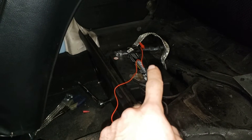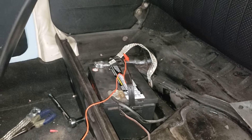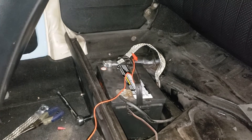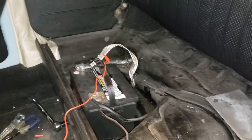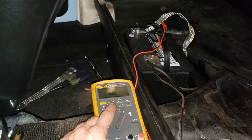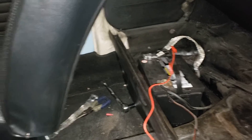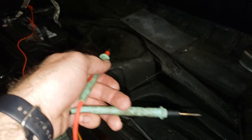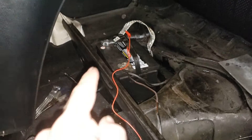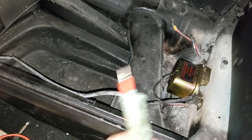We have a new ground strap, but we want to make sure there's actually a good connection to the body of the car. Just because the strap and the battery connection look good doesn't mean it's making a good ground throughout the vehicle. The way to do that is to use the continuity setting and check for a beep, not just from one end of the strap to the other, but from here to a clean bolt way over on the other side of the car. I checked from the battery negative over to the body of the regulator chassis — and that's good.